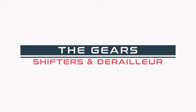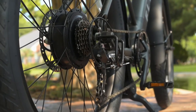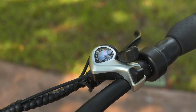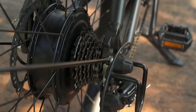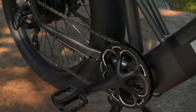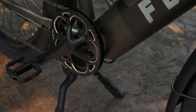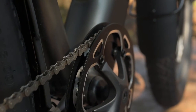Let's talk about the gears. The M880 comes with all Shimano gearing — a 7-speed derailleur in the back and the SIS index shifter on the right-hand side, which is super easy to use and very intuitive. We've also got a Shimano freewheel in the back, and up at the cranks a 53-tooth chain ring with 170mm cranks and a dual-sided aluminum guard. That's an excellent feature — it protects the chain if you bump the bike into certain things.